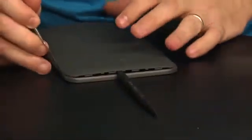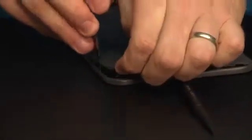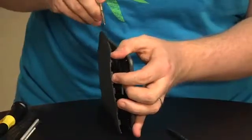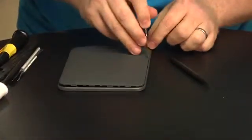Looks like pushing out at the edges is the way to go. It seems like the way to get this to pop open best is to gently insert a spudger in here and then pry out so that it releases the little clips — you can see them right here from the bezel edge. I'm going to do the same thing on the other side. Just work it down the side. Once you get it open somewhere, just keep working around the edges.